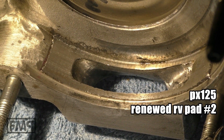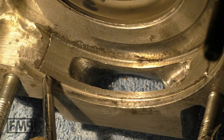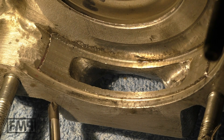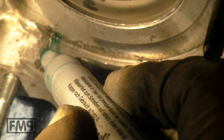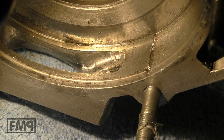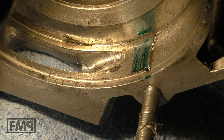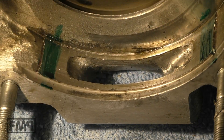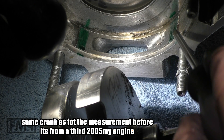With the renewed engine pad — I even asked to extend it a little bit to the front. Here is the old mark — it was just here. This area is longer than original. This was the original one; here is the old mark. I asked for extending it in this area. This crankshaft cheek together with this area here is the rotary valve. The distance between the cheek and the engine case has to be less than 0.1mm.